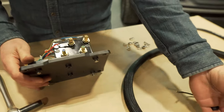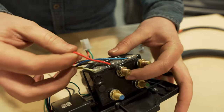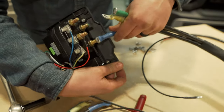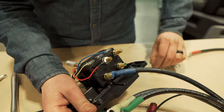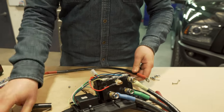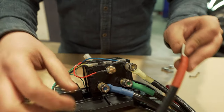Now we're going to install our extended wiring harness. Note that the small diameter red cable will stay on there. We'll start by putting the bottom two in — that's normally the easiest. There is also an 18-inch power cable that comes with the kit, because this is so much closer to the battery you don't need many feet. It goes on the red terminal. Just make sure that small diameter wire stays there.